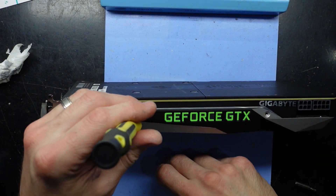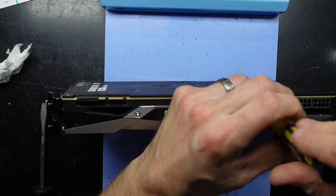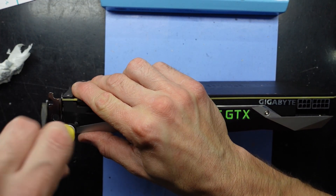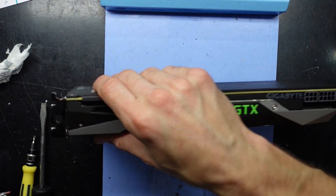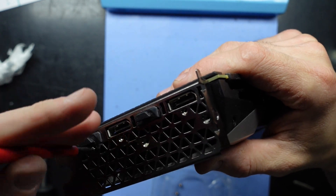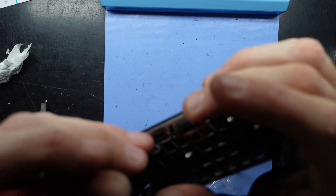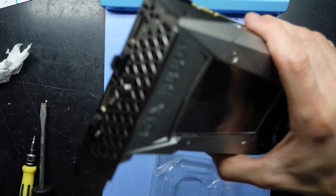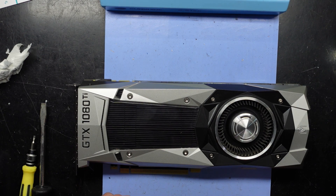One observation with this compared to the other ones I've seen — for example, the MSI 1080 Ti Gaming X. This one requires a six and an eight, where the other ones like the ROG Strix and the Gaming X do require two eights. So just a neat little observation there. And lastly, three screws across the front, which weren't overly necessary. Anyway, that's the extended way to replace the thermal paste on your GTX 1080 Ti Founders Edition. Hope that helps — see you later, bye!